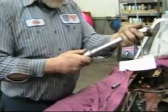We're going to start here at 15 pounds, which isn't very snug, but it's a start. I'm going to crank up my click torque wrench here to 15. There's going to be a lot of twirling here because all these nuts are relatively loose. I'm going to run this clockwise, so you'll see that I'm off to my first one here. I didn't tighten up the rocker shaft onto the 5/16ths studs first — certainly not, because that would tend to hold the cylinder head away from the block. I don't want to do that, so I'm going to tighten up the 5/16ths nuts afterwards. I'm running these down here to 15 pounds with a click torque wrench.